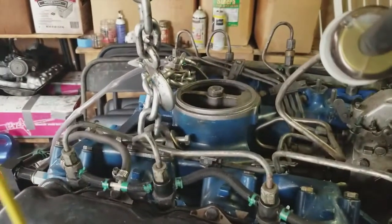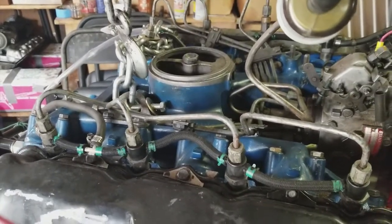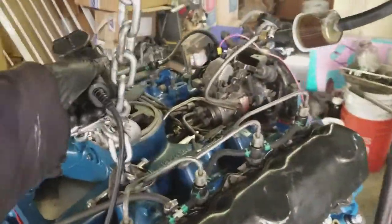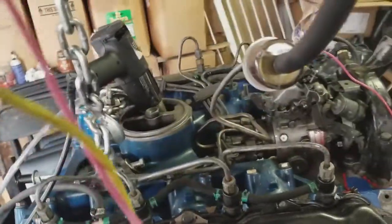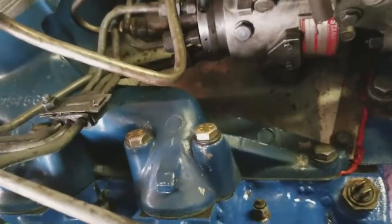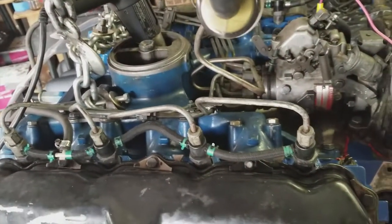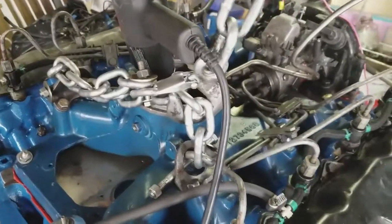I've been blowing hot air into the intake. I've got a heat gun that I normally use for that — I'll just jam it in like that. It warms up the intake. It's supposed to help because I'm not running any glow plugs. I mean, I have the glow plugs in, but I'm not powering them in any way. So the engine needs a little bit of heat to aid in the process. I don't really know if it actually helps, but I've been doing it and it seems to work.